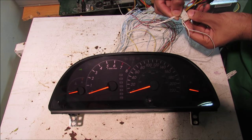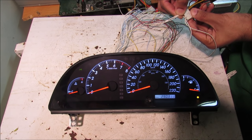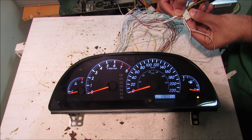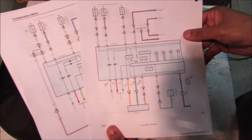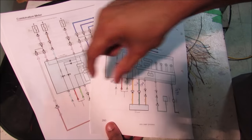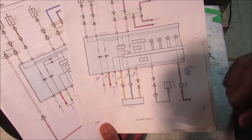Just to preview what this looks like, I'm going to power it up. You can see the needles light up first, then the speedometer, and then the two smaller gauges along with the odometer. Here I have my 02-04 wiring diagram and this one is for the new cluster, and what I've done is compared the pinouts for each one and determined that there are quite a few pins that I will need to exchange.